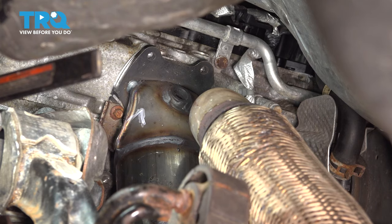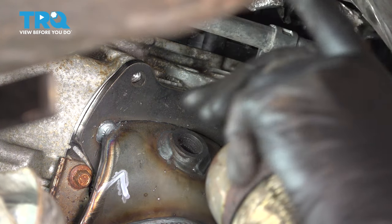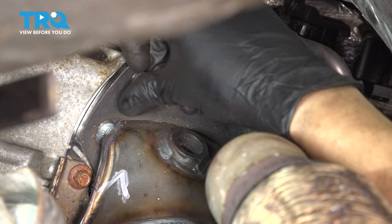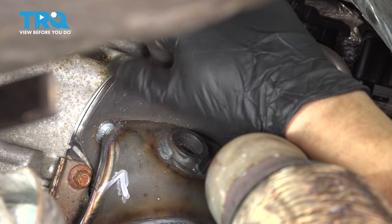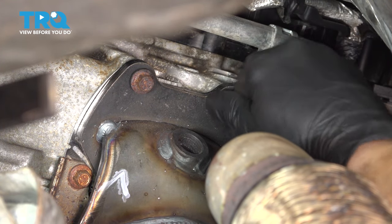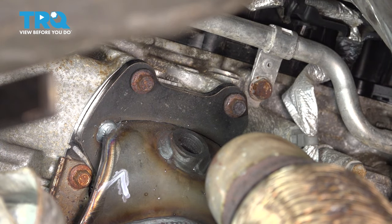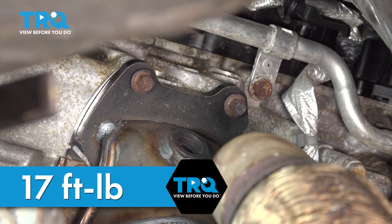The bolts are perfectly lined up at the top — start these bolts in. The torque for these is also 17 foot-pounds, just like the bracket. I'm going to start them in by hand to make sure they go in nice and smooth. I can't really get a torque wrench in here to accurately torque them, so I'm just going to make them nice and snug by hand. If for some reason you can torque them, 17 foot-pounds.